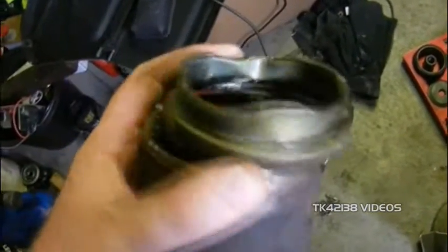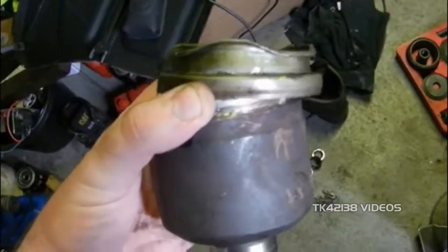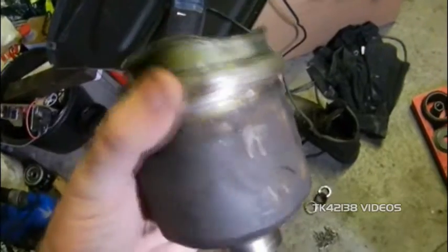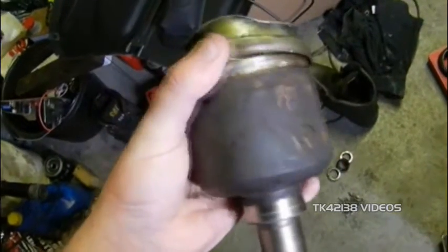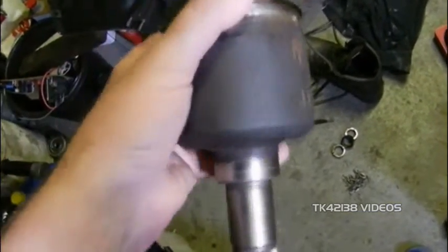And the reason why the rubber boot was split — so obviously I've got to put a new boot on. I could use a stretchy boot and save all this hassle, but I don't like stretchy boots anyway. They're good if you want to get a car through an MOT quickly, but in my experience they don't actually last. It might last longer on an inner joint because the inner joint is only basically moving in and out as the suspension goes up and down.